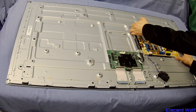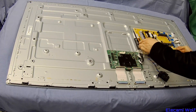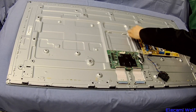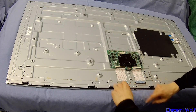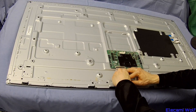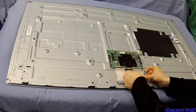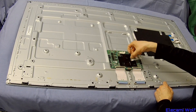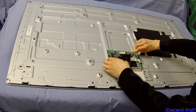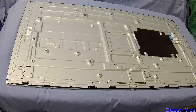Then we're going to lift up the latch — there's the latch here — and slide that off. That's the main power board. Then there are delicate ribbon cables going to the panel; we need to lift up the clips there and carefully slide the ribbons out. There's a latch somewhere here — lift that board up slightly and slide it across. Now we've got the bare panel which we need to get rid of and bring in the new one.